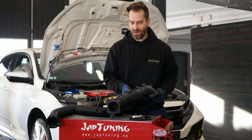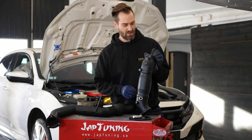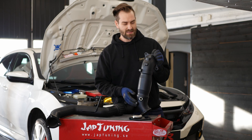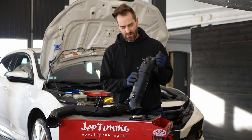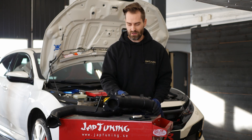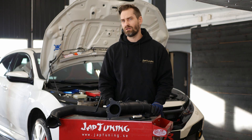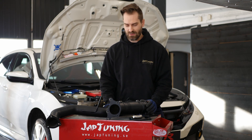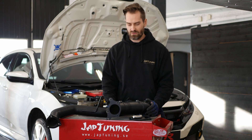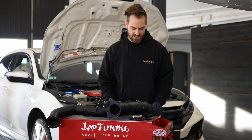The pipes you see here are black. From PRL they are not black when you get them — we have had these parts ceramic coated here in Sweden. There are a couple of reasons for that. First, to keep the heat inside and reduce heat radiating out from the pipes, giving a cooler engine bay. Second, here in Sweden we use the car all year round. In winter we get snow and a lot of salt on the roads, which will cause the pipes to corrode. The coating protects them from that.